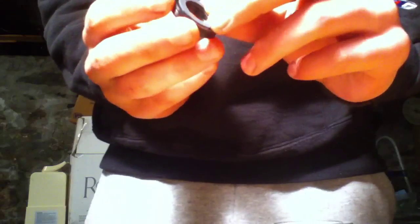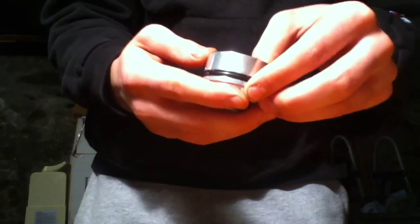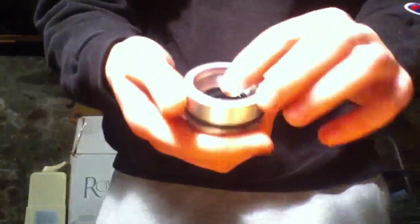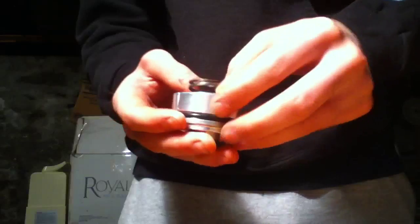Next part is to get the actual oil seal in. This is a two-part seal — you've got the rubber part and you've got the gray part. The gray part goes face down into here. I'm just going to assemble that and shove it in all in one piece, get it to all fit in there — and it's in. The next step is there's a washer that goes on. Feel for the smooth side and put the smooth side towards the seal, like that. It fits right in there.